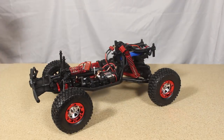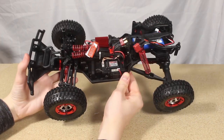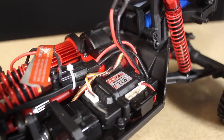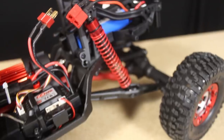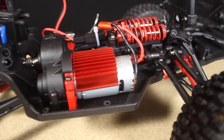Taking a look under the lid, you can see how the suspension layout is similar to that of a full-scale trophy truck. The only major difference is the Fighter-1 uses a pushrod suspension in the front, which places the shocks where the engine would be in a front-engined full-scale vehicle. The electronics are basic, and due to the ESC and receiver being one unit, and the non-conventional steering servo plug, upgrading just one of these components would require all three to be upgraded at the same time.